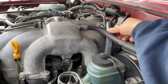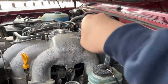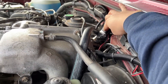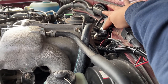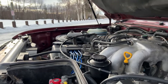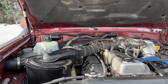I already replaced the pesky heater hose and removed the hard metal line — it goes from the heater hose straight to the firewall. This right here is the relay switch for the LEDs. The engine harness is leaning on the EGR pipe, which is hot, so I wrapped it with heat-resistant tape. I've seen people burn up their harness — that can be a big issue. I figure I might not do the EGR delete, because one day I might move down south where emissions testing is required, so I'll just leave the EGR the way it is.